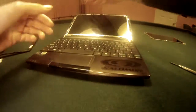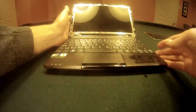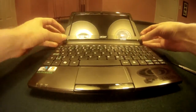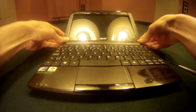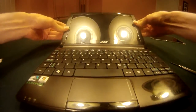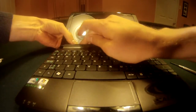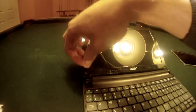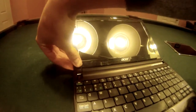We can stand our laptop back up and now place this plastic cover back on. You're probably going to want to bend your laptop as far back as it will go and then just snap this in. You should be able to hear it snap all the way around, including this middle area here. Put those two screws back in and behind the other circle. If you can, try and put the circles back on — sometimes they lose their stickiness but try your best and they should go back in.